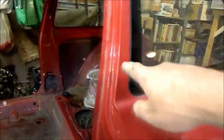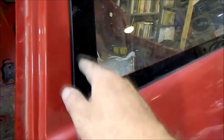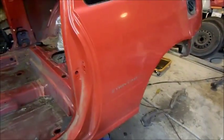This thing here, going to take all those lines out down there, is absolutely empty. There's Zippo and even the headline is gone. Interestingly, Toyota fitted bolts up here to this support here, but I think they bolted it then welded it. I'm not really sure why it's like that, but it's still too complicated taking that turret out. I sort of reassessed what I was doing. I'm about to start cutting this rear quarter off here, which means drilling all down these spot welds. Got to pop that window out and drill all along there. I want that for the other car because it's in absolutely immaculate condition.